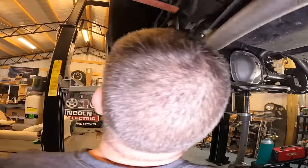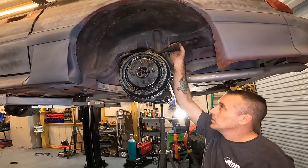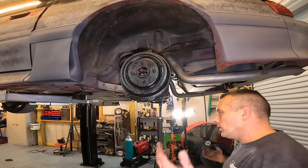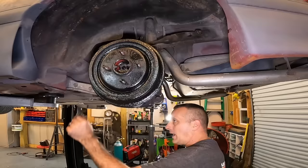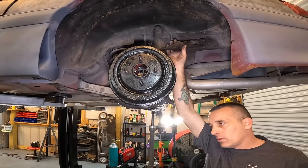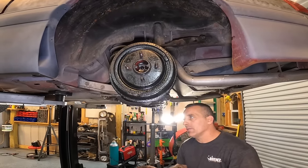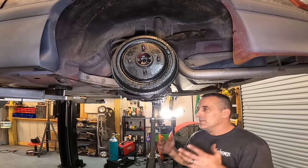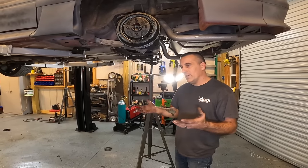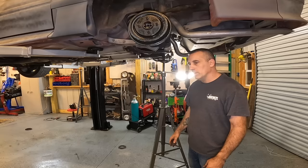Andrew brought up a good point — which is rare — but we're going to go ahead and probably just flip these shocks because the new wheels are going to probably rub. So we'll probably go ahead and do that. If you guys don't know what we're talking about, we're just going to unbolt this and literally flip the shock around. I know a lot of you are going to say just take the quad shocks off, but I prefer the ride with the quad shocks. Anytime you've got cut springs or a higher spring rate, these do help dampen the load. Especially if your shocks are already a little worn out like these are, these will help you. So we're just going to flip those around, bolt all this stuff up, drop the car down, and show you the difference that no money spent can make on the look of your car. Then tomorrow we're going to put the new wheels on the car and show you the stance difference.